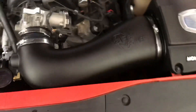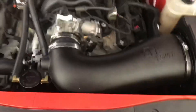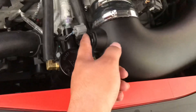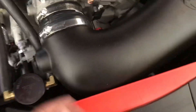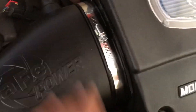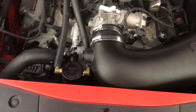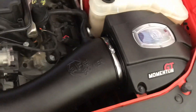Finished product — everything's on, plugged in, factory grommet and crankcase line connected. One crucial tip: be very careful taking your factory temperature sensor out — I broke mine. It's nine dollars from O'Reilly if you do break it. Make sure you put your coupling and both clamps on before you install your tube, then tighten them all the way down — I used a screwdriver then finished with an 8mm ratchet. Use your factory hardware to mount the box.